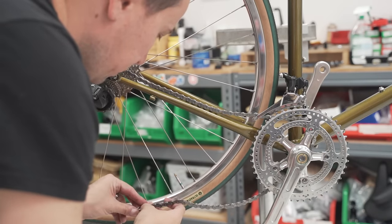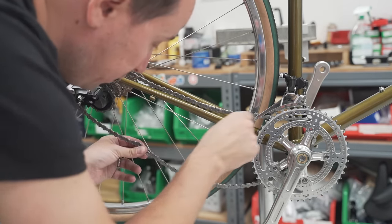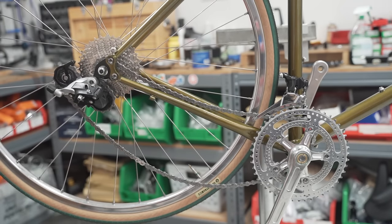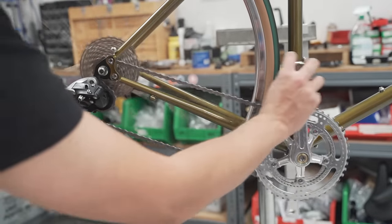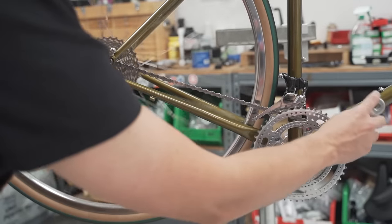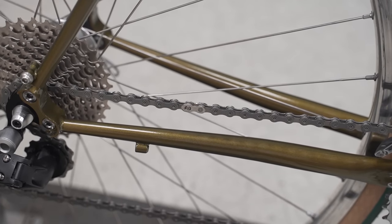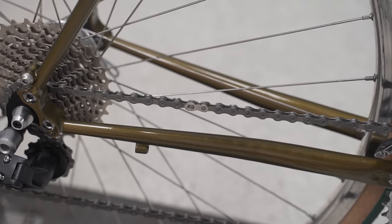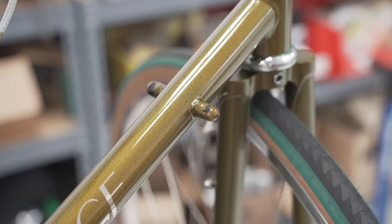Quick links going in. I take it off the front chain ring so it's a little bit easier, so you're not fighting the tension of the derailleur. So now we've got to set the quick link. Run it through until it's at the top. All right, now we're going to take the bike down. Per Shimano's infinite wisdom, once you have the link set in that position, you just push on the cranks. That's it. Let's get the shifters on.